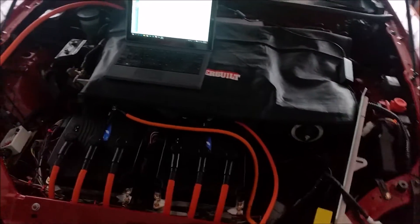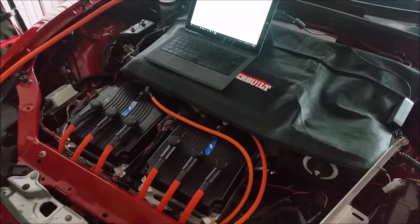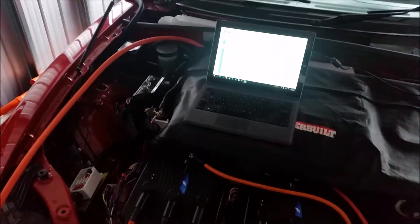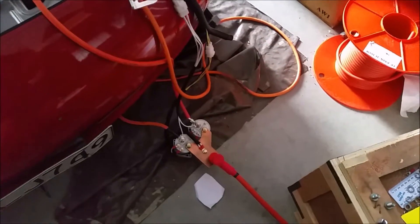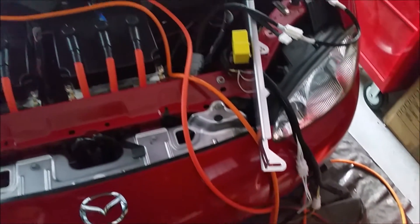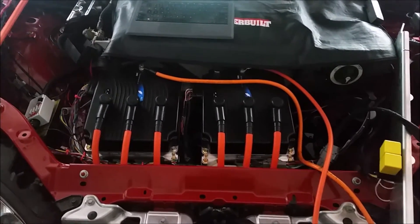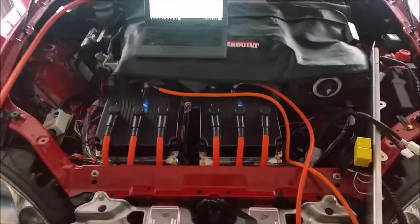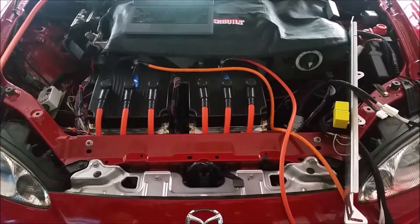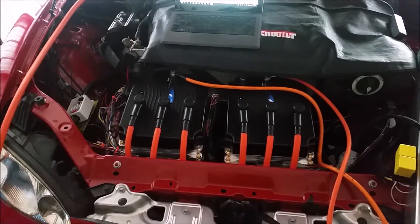Unfortunately I'm going to have to leave it here for a little while while I shoot off to Australia for a week. As you can see, everything's buttoned off. I've got a very temporary arrangement going on here with a lead running off to a box full of cells, all strapped up, running around to the positive, with the motor contactor there and off up to each of the controllers. I've got about 106 volts on it at the moment, so I had to hop into the programming and turn the voltage limit down on the controller so that it would actually connect — down from 144V, set to 100V. The pre-charges work fine and the contactors work fine.